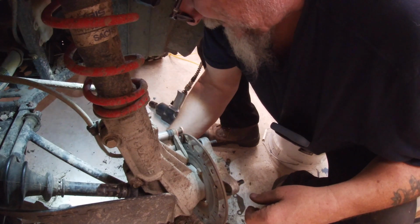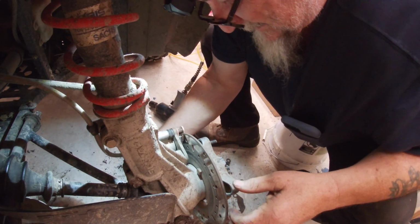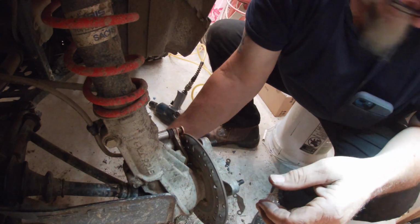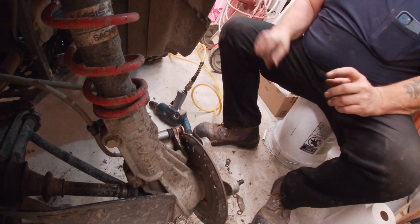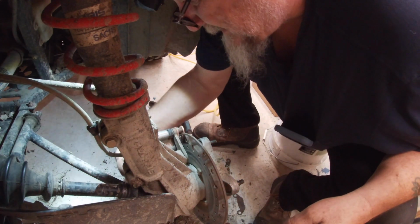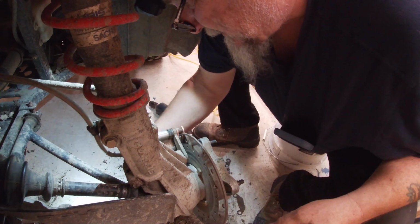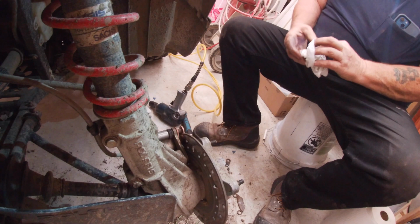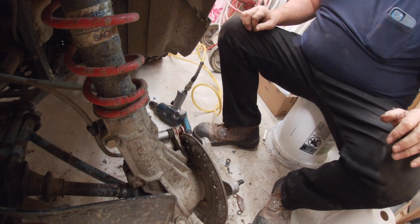Maybe. I got a lot of grease out of the back of that one. Maybe 50 hours worth of riding, if that. I heard it snap the seal, though, when I was greasing. I'm going, it should be out. It usually pops out the front, but it came out the back. A little grease on the brakes won't hurt. I can put a fair amount in there. I didn't see any mud bogging or water this year, so.